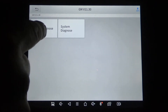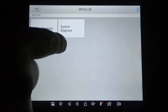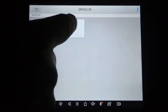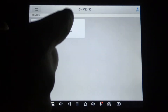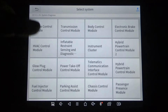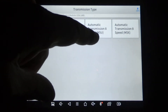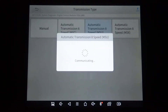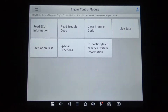If you do Auto Diagnose, it will go through and look at all the codes. I will say it is faster than my Autel when it comes to doing that, probably because it is tethered by a cord — the Autel is Bluetooth, so it has to go through wireless communication. We're going to go through the different modules. This is a 5.3, and it does have the RPO code M5U, 8-speed transmission. We're going to quickly go through and see what the actuation test and special functions offer on this scan tool for this vehicle.